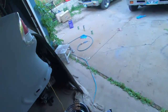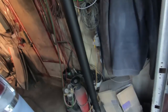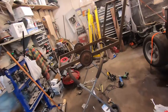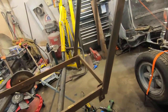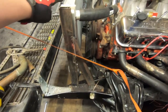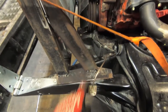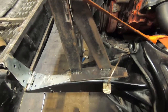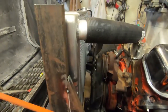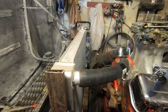I cleaned up the driveshaft - took a little flak on Instagram for using a used driveshaft, but you can't even tell, it looks brand new. I'll get a few U-joints for that and should be able to slam it in this weekend. So I've messed around here and this is my rough idea - it's just tacked together, but it's got a little bit of triangulation and I'll be able to bolt it right down to the frame. It'll sandwich the bar that runs across underneath.